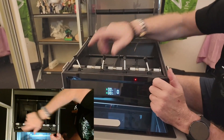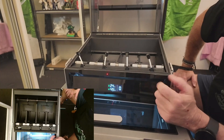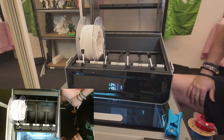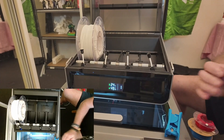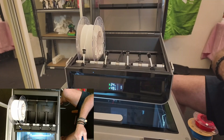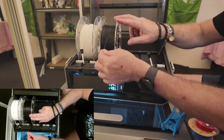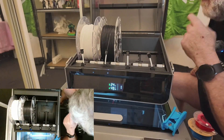One thing I forgot — this little sensor can go back in here. While it's running, the red light means something's not right — and in this case, it's because I don't have filament in it. Let's put them back in. Black was in number two. The bits I pushed in on the sides I'm going to have to cut off because they will have little bends in them. I'll put this in now — it should go freely like that, and if it's getting stuck that's the one that's caught.